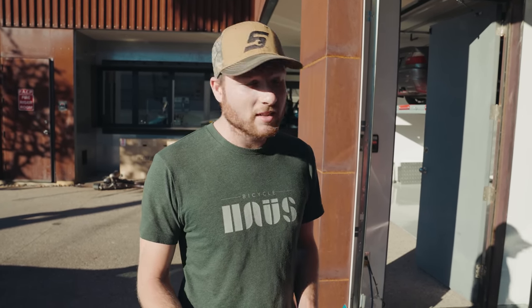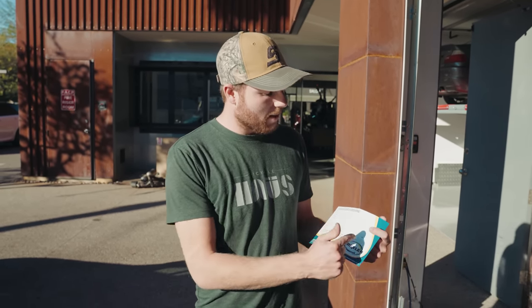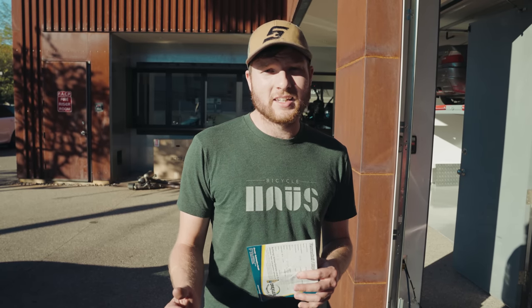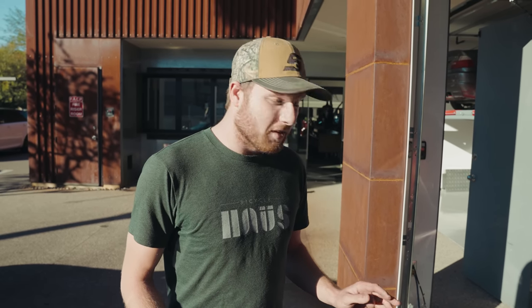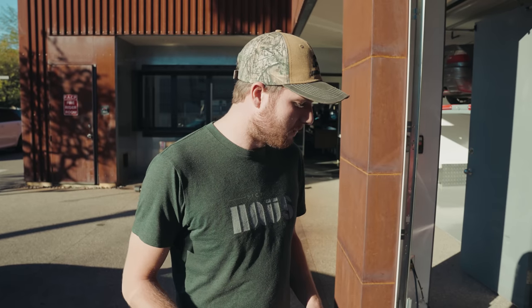The reason for it is the way that it's composed, the way that it works is at the top of everyone's game. BMW Motorsports use them in all of their cars. You can buy these from the factory, you can also have them installed like we did. The benefit of having them installed is that you can actually set the ramp angles up to the way that you want the diff to react. Now this has been set up for track, but it's not the highest of aggression, it's kind of like one step down, so it's also good for the road as well.